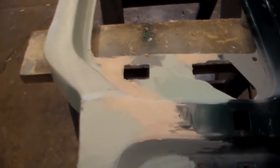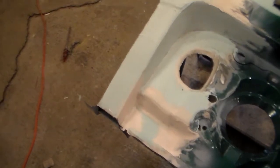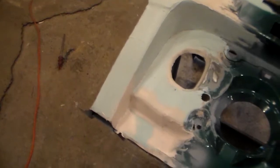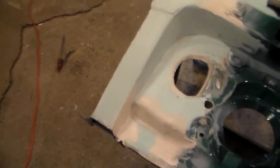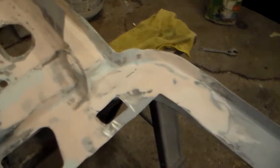With the glazing filler applied, for sanding instead of 80-grit paper I'm going to use 120-grit — a little finer so there are fewer scratches from here on. Use the dual action sander, sand by hand, whatever access the situation requires. Finished sanding — time-consuming with all the edges on the back, but the front went nice because it's nice open space. Here's a shot of the rear sanded.